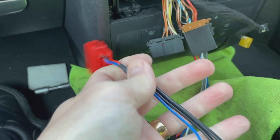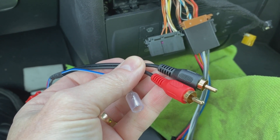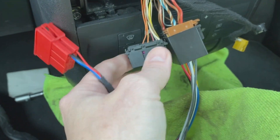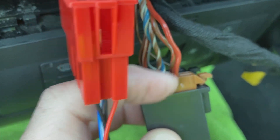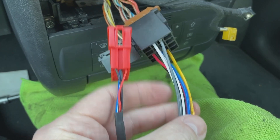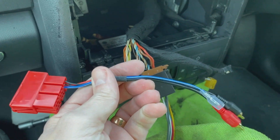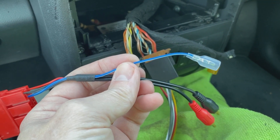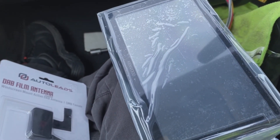Because this vehicle is amplified, you get this extra cable in the pack you're going to buy. Plug that in, then use these phono or RCA plugs to plug into the rear output on the back of the radio — I'll show you this when the radio is fully plumbed in. The blue wire is to switch the Audi amplifier on and off with the ignition, so you don't want the amplifier on all the time.